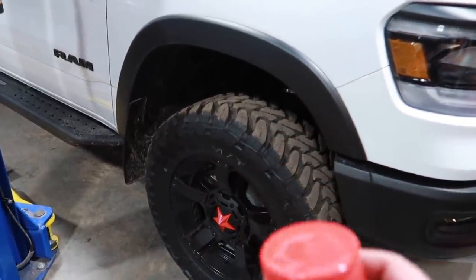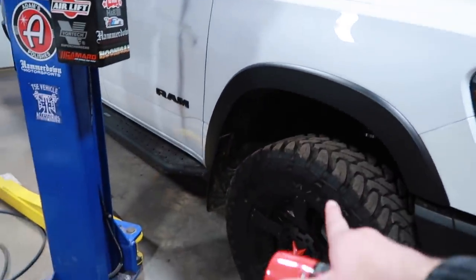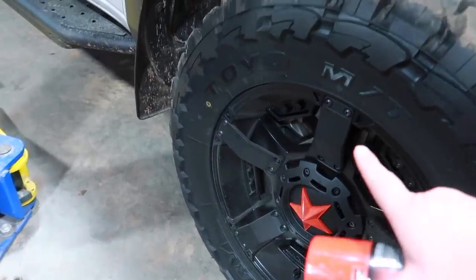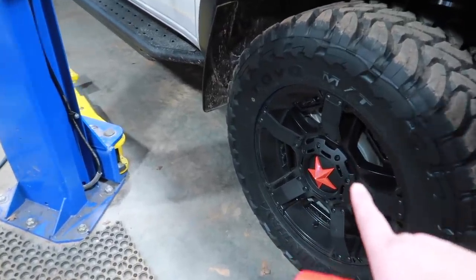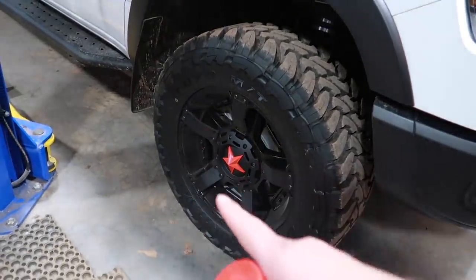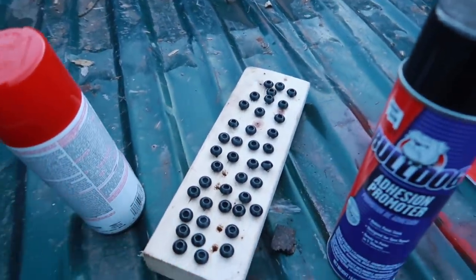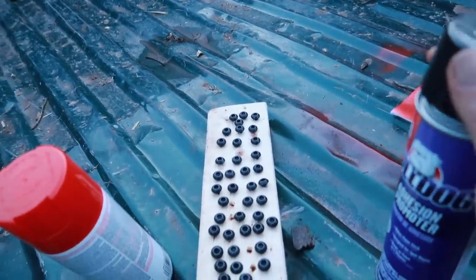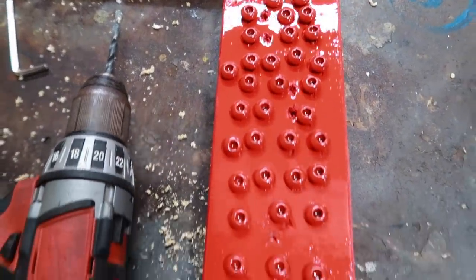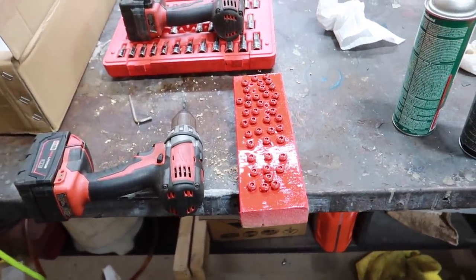Now that we have the right color paint matching the star pretty much bang-on, we're going to take the bolts out of where the spokes are — these are removable on these wheels, you can actually remove the spokes and change the color. I like them in black, I just want to add a couple more accents to draw the eye away from the center of the wheel. Here in our state-of-the-art painting facility — aka the back of the F-150 — everything is nicely degreased. We're going to throw some Bulldog adhesion promoter on these and then we're ready for paint. You can see the red in the light compared to our star — very, very close. We'll let this dry overnight and hit it with a couple extra coats tomorrow, then reinstall.